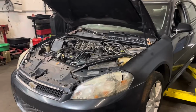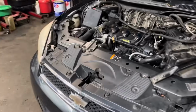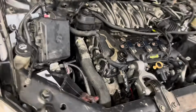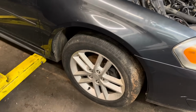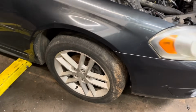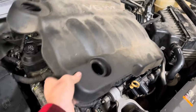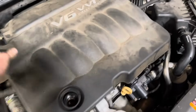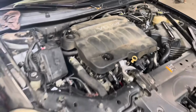Yeah. Lucky. And I have from the back seat the final piece of the puzzle. Dad just topped it off with oil. We chased down an electrical issue for the ABS. It was a broken wire in the harness between the PCM and the ground side of the front right wheel speed sensor. So we just threw a patch in there and let that ride. There you go. There's your final piece to the world's ugliest puzzle.